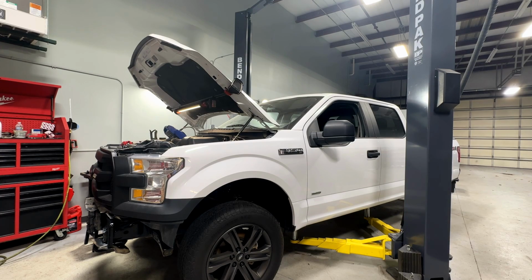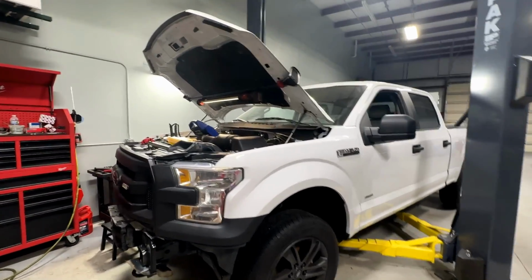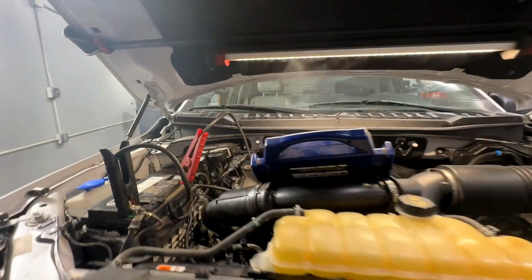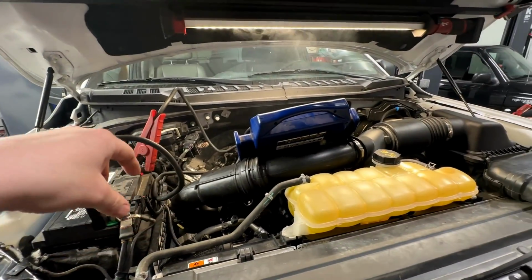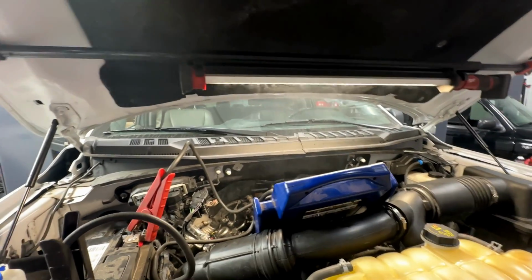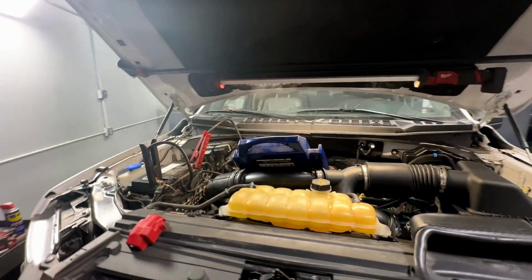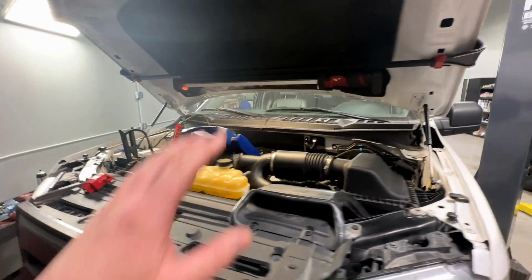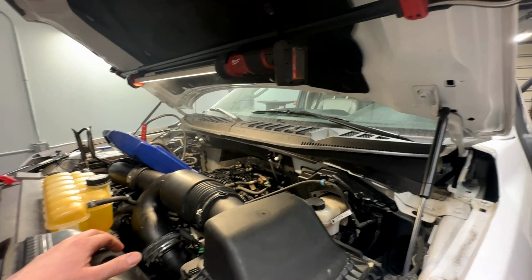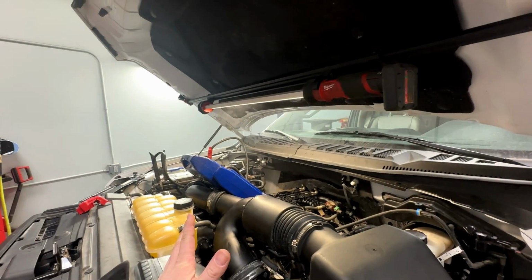So you see it smoking now. And again, whenever you do any kind of major engine work, like I do timing jobs a lot of times, the oil gets splashed onto the manifolds and all that stuff. Smoking like this, it's perfectly normal. You're always going to have some of that going on there. And we have all new turbos and manifolds, and everything's coated in oil so that it doesn't rot by the time you pull out a box. And guess what? Now it's time to burn off.